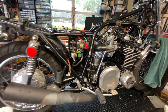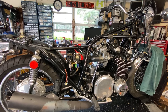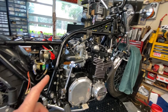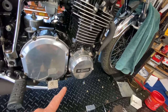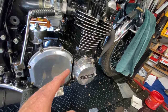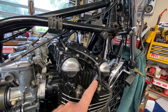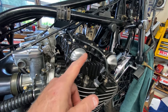I believe we have an electrical issue — voltage drop causing current loss. Several things are participatory in the running problems, especially at lower RPM. I triple-checked the points and they look good. I couldn't get reliable capacitor readings. Timing is exactly right. What I did find was that two of the spark plug caps — the 5 kilo-ohm resistor caps on cylinders two and three — were bad. One was completely open, the other had resistance jumping all over the place.